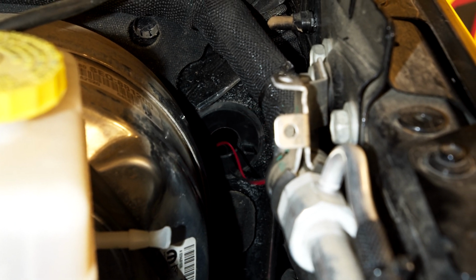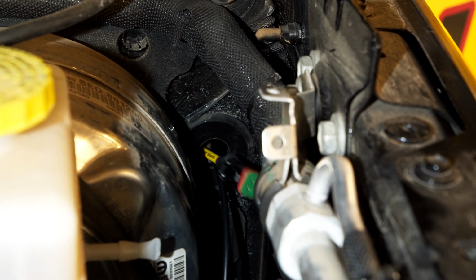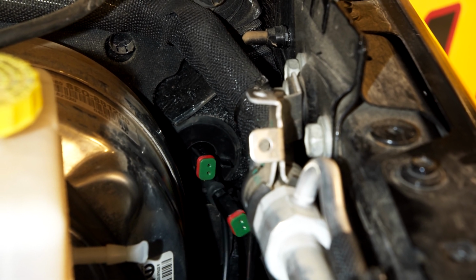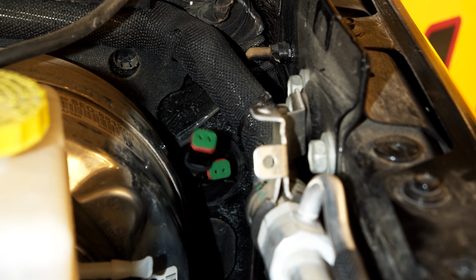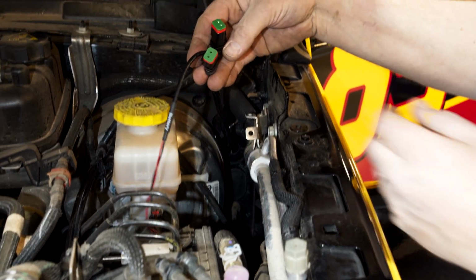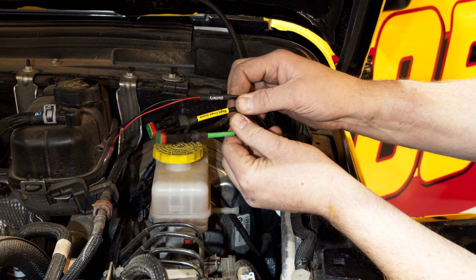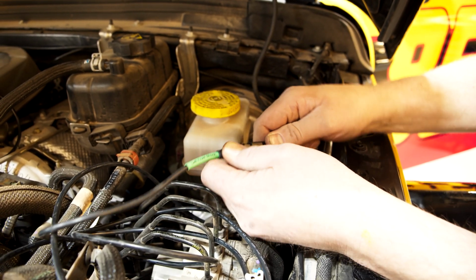On vehicles with manual transmissions, you will need to send the wires through the drain plug under the rear seat and run the wires along the frame. Connect the front left shock wire to the shock. Tie off any excess wire.